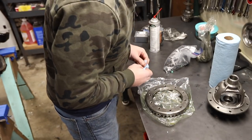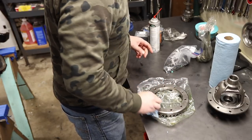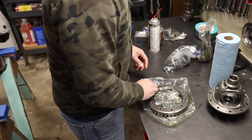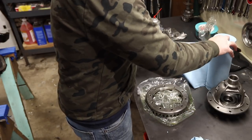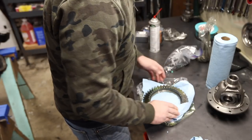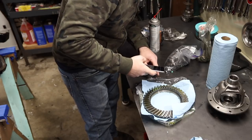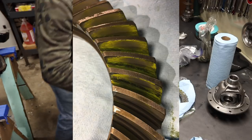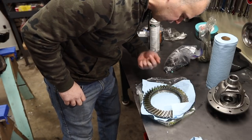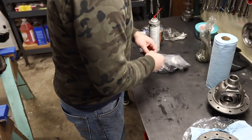There's a lot of oil inside those threads. I used blue Loctite on the Ford — I might use red Loctite on this one. People kind of go back and forth on the Loctite: some people say you absolutely have to do it and others say you don't, so just like everything else there's no shortage of opinions. One thing I didn't do on the 9-inch: take a picture of the pattern they've got right now. You won't necessarily achieve the same pattern because they use a special housing that's all jigged up and perfect, but at least it gives you something to shoot for. This one is actually pretty high up the tooth — on the 9-inch I try to get a little more centered into the ring, but maybe that's just because it was a 9-inch.